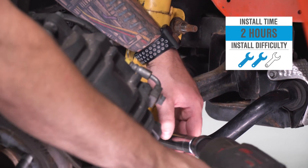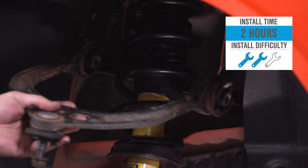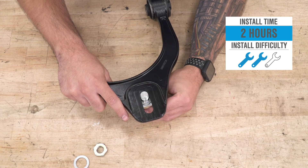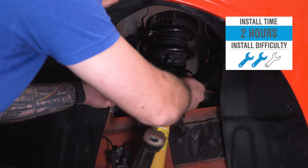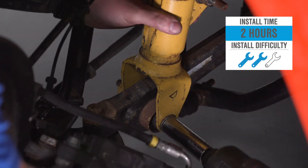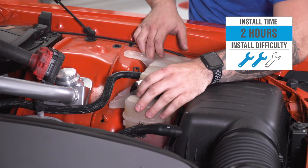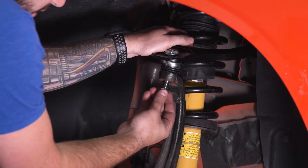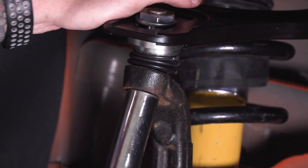The install itself is fairly straightforward — you're essentially just going to remove the upper control arm bolt and then remove the two connecting it to your wheel well. I'm going to show you a process that includes removing the entire strut assembly. That is not required for the install, but I'm showing you that route to give you a better look at exactly what you're dealing with. The strut can be a little in the way when getting those two bolts out. It'll take about an hour from start to finish, maybe two hours depending on your experience and tools.